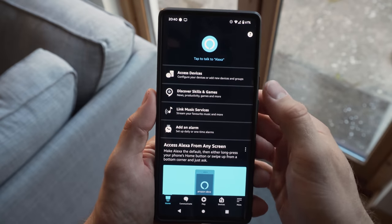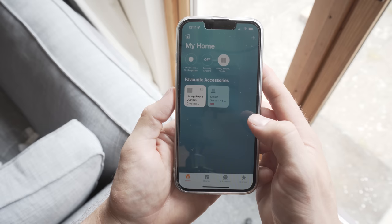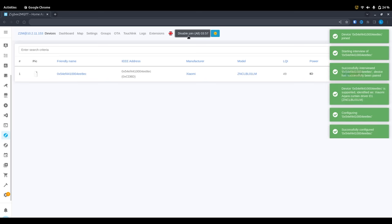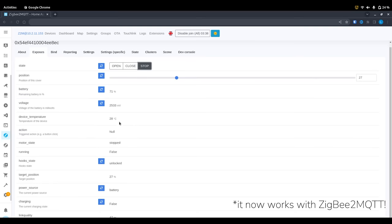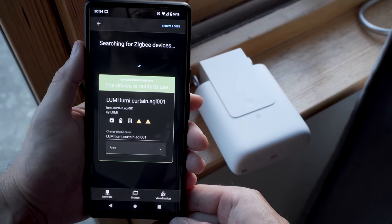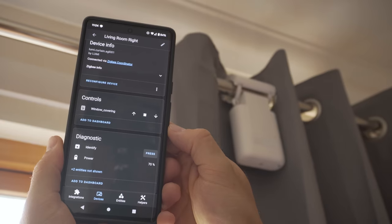If you connect the Curtain Driver E1 through one of your Aqara hubs, it can link with other smart home platforms like Alexa, Google Home, HomeKit, and Home Assistant through the HomeKit integration. If you already have Zigbee on your Home Assistant server, you can directly connect the curtains to bypass the Aqara hub altogether. I tested the Curtain Driver E1 with both Zigbee2MQTT and ZHA and had a surprising result — it wouldn't work in Zigbee2MQTT at all, but it did pretty much fully work in ZHA, other than battery life not showing up.